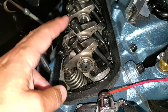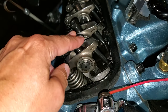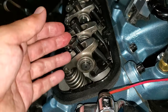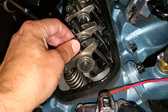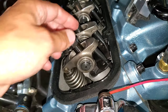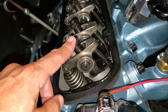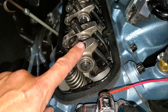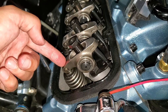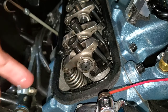There are several ways to pick which valve to adjust. One is where you turn the crank 45 degrees at a time — there are two valves on the base circle, like an intake on cylinder two and on six, or on seven you'd have the exhaust valve to adjust. That kind of works, but some of us have different cam timing and you don't know if you're approaching lobe lift, which can screw up your settings. What I like to do is one at a time, front to rear. To find the base circle, we want the polar opposite of the lift — slowly rotate the crank, you'll see the valve go all the way down, and right as it starts to come back, we're going to stop.